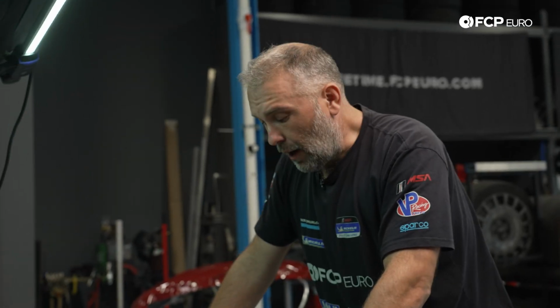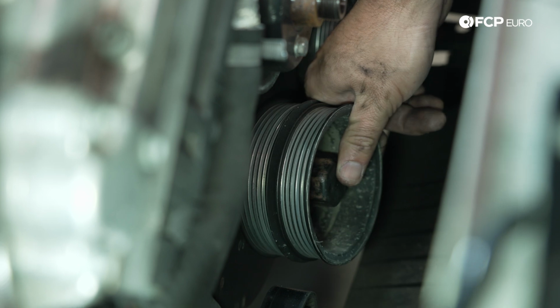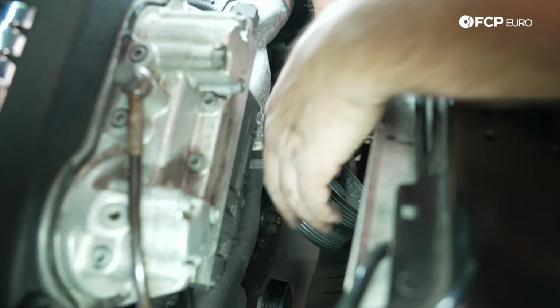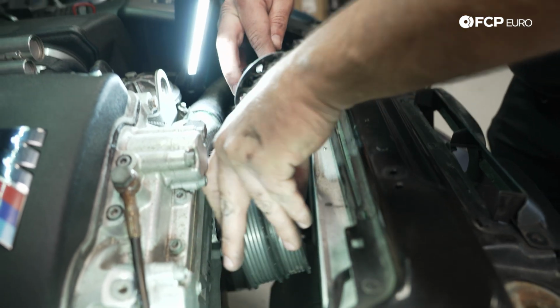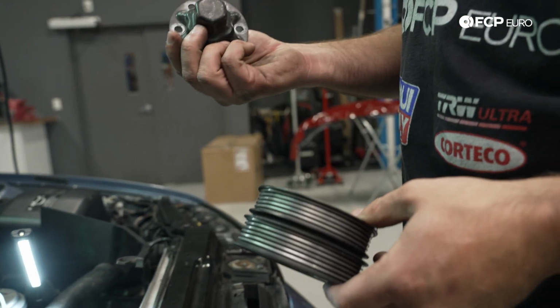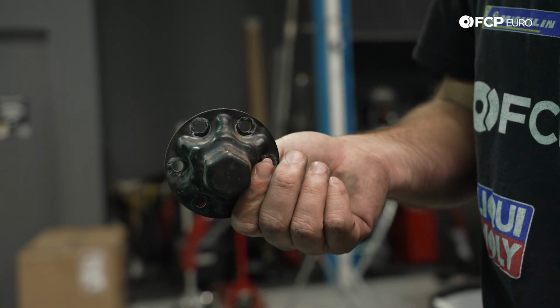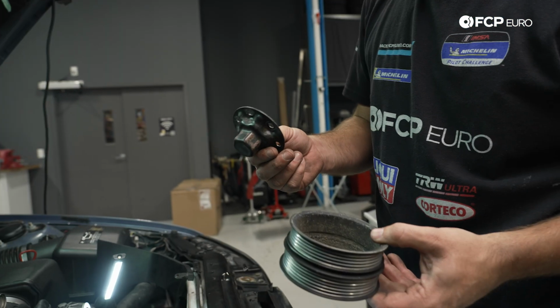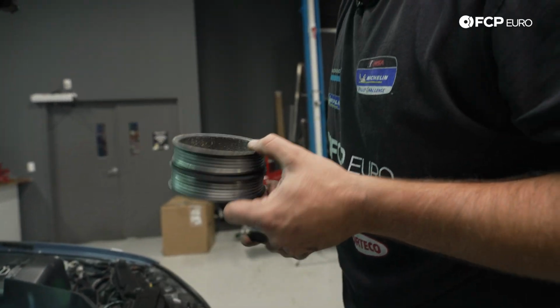All right, so after taking out the 6 bolts that hold the cover to the crank pulley, the cover and pulley will both come out together. So we simply reach down and grab them. And this is the cover I was saying that you could technically turn the engine with, but it's just stamped and it's got corrosion on it. And I'd rather just turn by those 4 bolts that are holding the harmonic balancer to the crankshaft anyway.